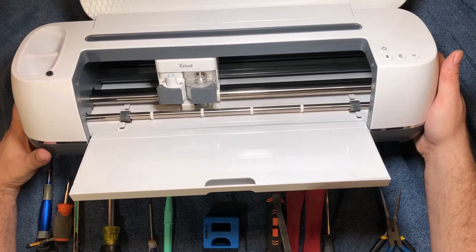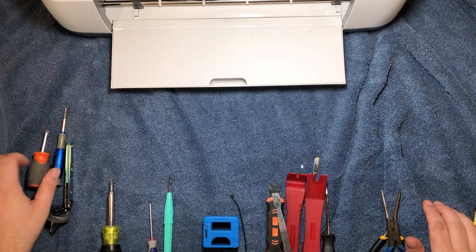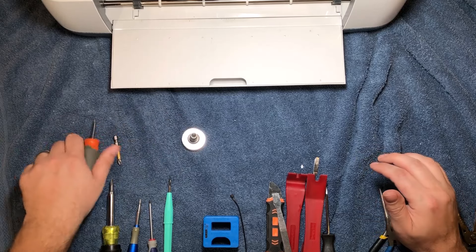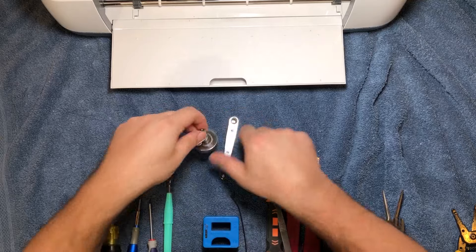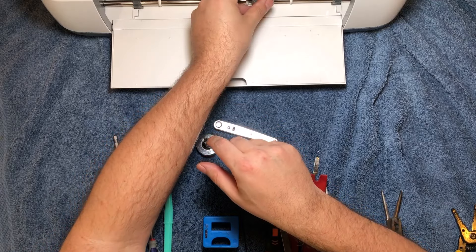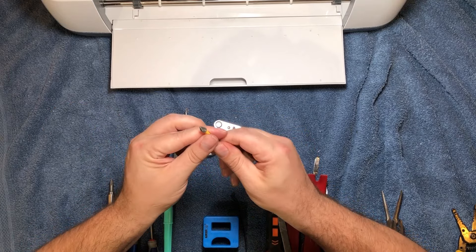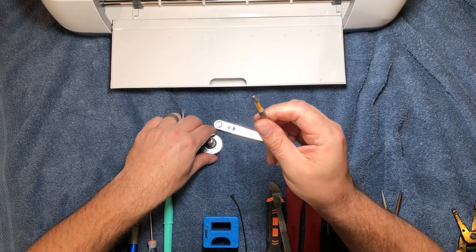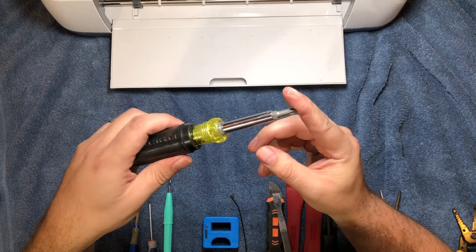Before we even start taking this thing apart, I'm going to show you what you need and what would be helpful. You are going to need some shorter Phillips head screwdrivers because we have to get in some weird places. You really only need one that you can torque — I recommend one of these little ratcheting things with a Phillips bit. You can also use a 90-degree ratcheting thing, or a little shorty screwdriver, though that might be a little tight. You want the smallest one you can possibly get. You can also grab one of these bits and try to do it by hand, using a pair of pliers to turn it. You will also need a standard number two Phillips screwdriver.